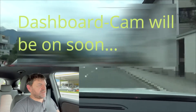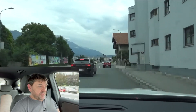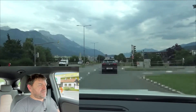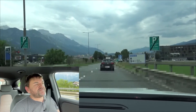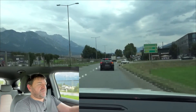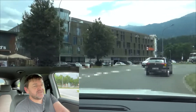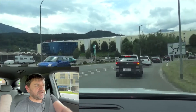I do this loop four times. The first two laps I try to regenerate as little as possible — or to use a different word, brake as little as possible — keeping the car in motion and avoiding a change of speed. In lap three and four I will do the opposite, trying to brake more and regen as much as possible. I won't accelerate harder, but I will just try to keep the speed longer, which then makes me brake and recuperate energy back to the battery. After the four laps we should have found out which way is more efficient. In theory it's clear and obvious, but we check whether it's true in practice as well and if this helps to convince the doubters.